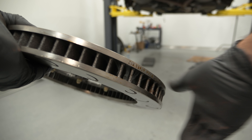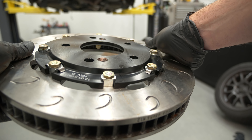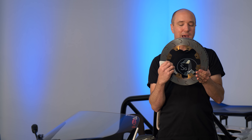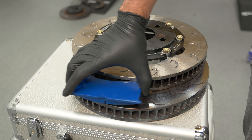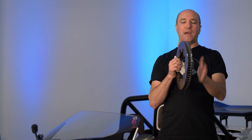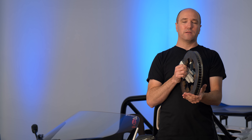These are made for performance, not aesthetics. When you look at brake rotors like this, you get into a directional vein design — more cooling veins, more directional veins — so you have to put it on the right side of the vehicle or you're not creating the airflow you need. They also use a J-hook design instead of standard slots, which gives the pad more of a place to bite into, strategically placed so it's not going to crack the face of the rotor as easily. The benefits are more cooling, better design, and proprietary metallurgy that's more resistant to cracking. The negative is to buy into a system like this, you have to change your caliper and pretty much your whole braking system.